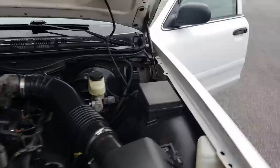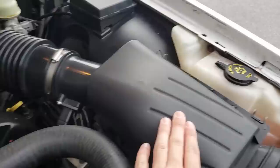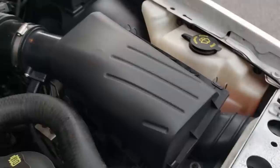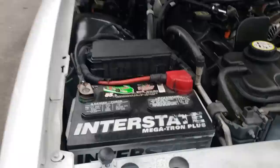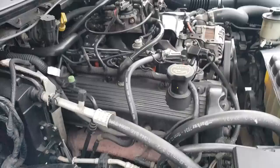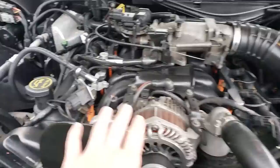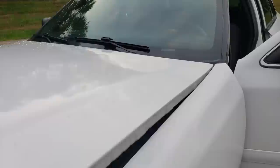We'll pop open the hood. Right here in this box is what they call the 'cop chip' — P71s only. Just kidding, nothing's in that box! But compared to a civilian model, you do have a different tune, a big air box — the same air box found on the Mercury Marauder, which is a totally different animal. You've got a battery the size of a small Honda motor; this thing is genuinely massive and costs about $300. Other than that, you've got a 4.6-liter two-valve V8 putting out around 270 horsepower, more or less depending on who you ask. Everything's real easy to work on — the alternator is right there, belts are easy to get to, and being a 2004 I still have a mechanical throttle cable.